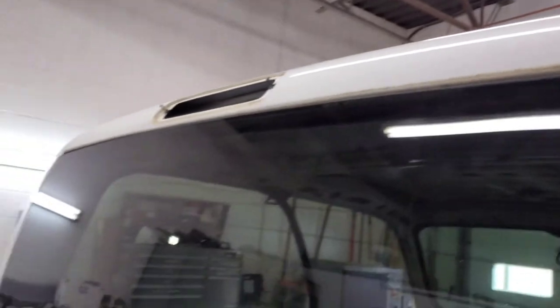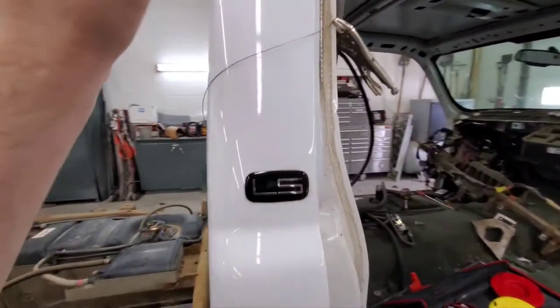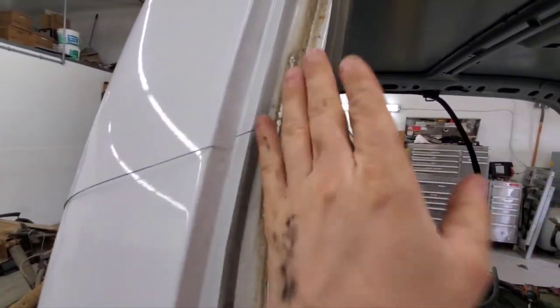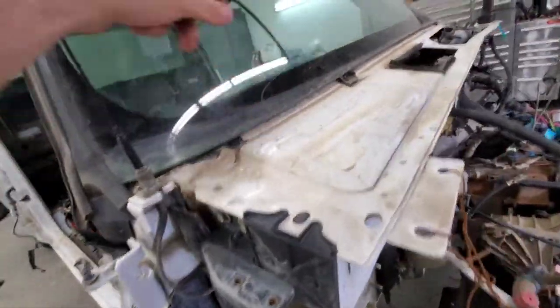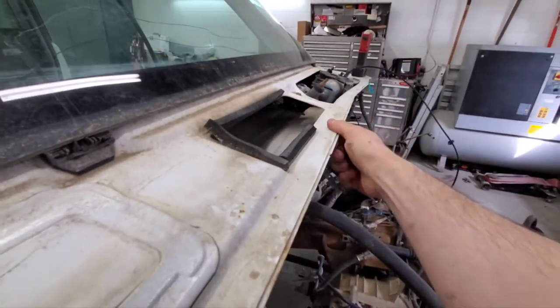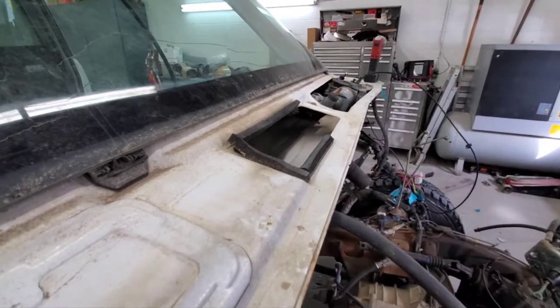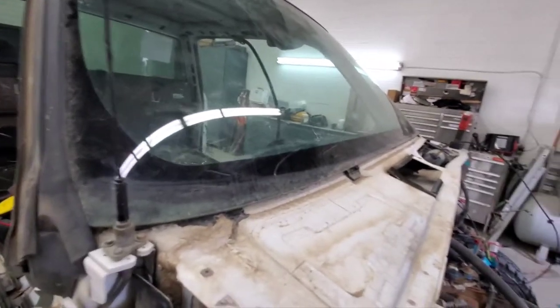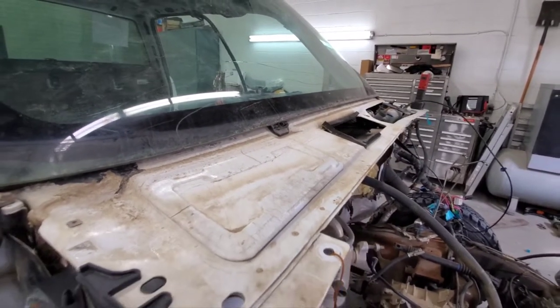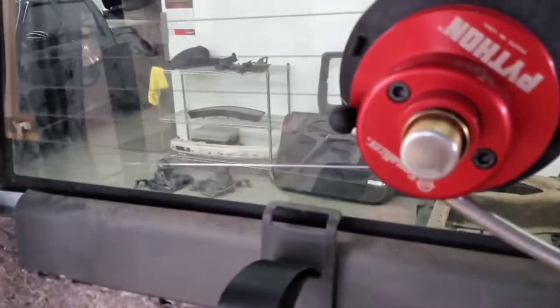I've got the wire wrapped all the way around the glass. Usually they want you to stick the wire through and hook it up, but I'll show you my trick. Take my wire, clamp it, and put a vise grip somewhere. So if you're doing a truck, you stick it through here, go around, your wire finishes here, and I would clamp it to the cowl — because you've got to usually take the cowl off anyways to take the glass out. On a windshield, I'd clamp it somewhere tight around there. This is way easier and way more solid. When I initially poked it in and fed the wire through, I have it looped around the tool. And it is as simple as spinning this around.